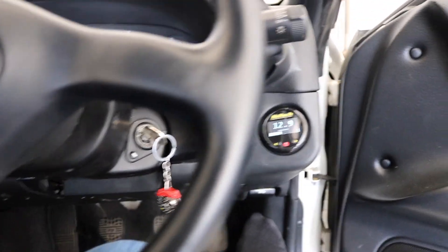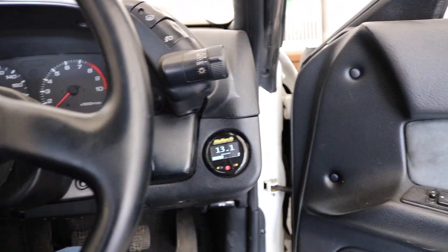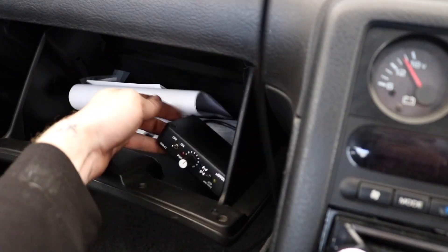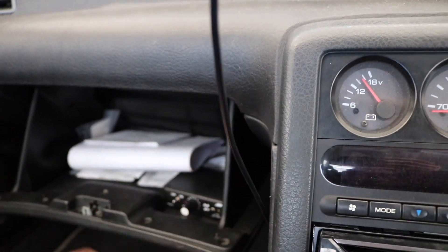Just to smooth it out, we will be going to ID 1050s here in a second and we'll be running E85. I got everything back together. Got the diff control — the Altessa controller right here. I think I'm just going to get some double-sided tape to stick it there.